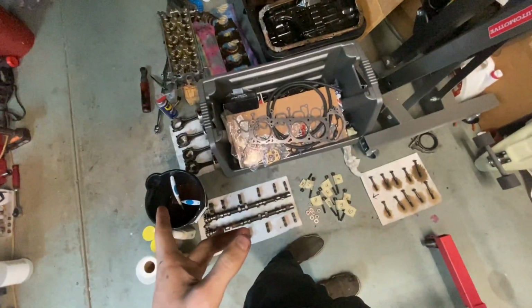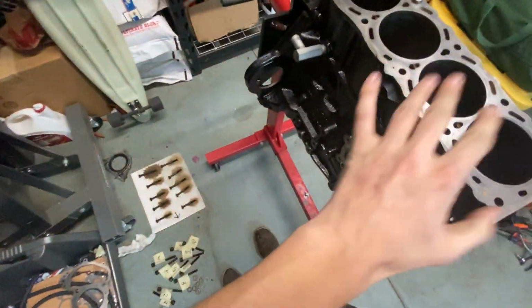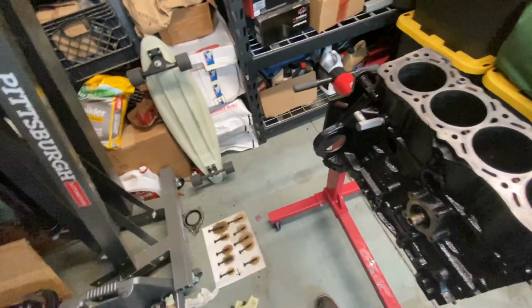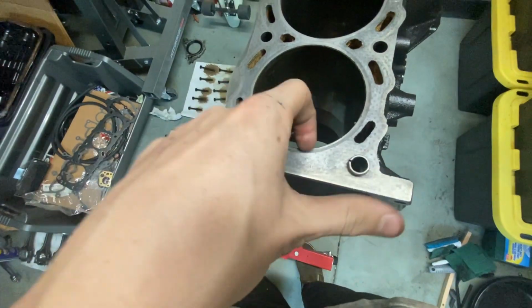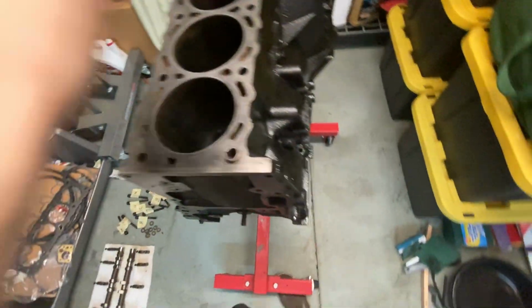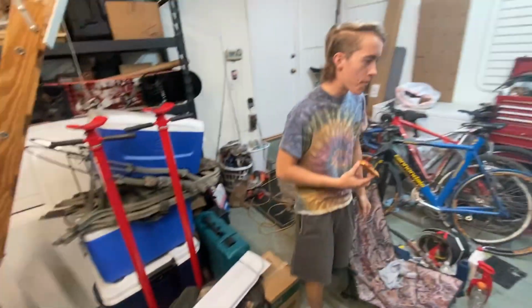I definitely want to do piston rings. And wrist pins. Yeah. And I think that's all I'll do. I don't know. Use the rods and the pistons on the other block. So then I'll have a spare block and a spare crank. So yeah, who knows? If that block looks like the cylinders have good cross hatching, I might just use that block even though I just painted this one.